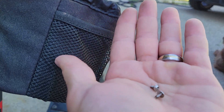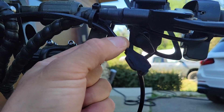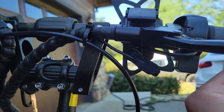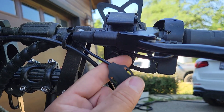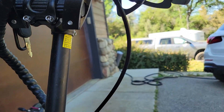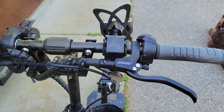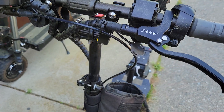So you can see the two little screws — this is what the magnetic switch looks like. It's a simple flat piece that just senses the trigger pull of the lever. As soon as I disengaged this, all regenerative braking was disabled in the scooter. And all of a sudden the brakes became completely predictable and completely safe. No more grabbing.